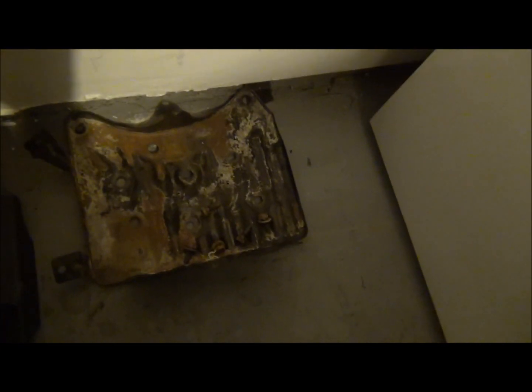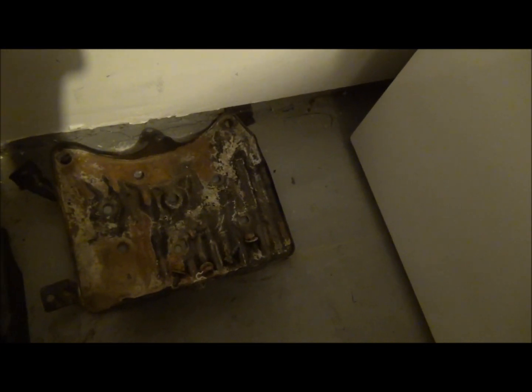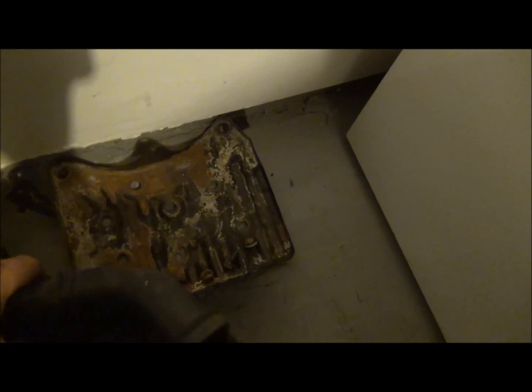There's a little tray underneath the battery, which is right here. And then you want to pull the actual battery tray out itself, which has 5 12mm bolts. About an 8 or so. Either way, there's going to be one back in each of these corners, and then these 3 you can see pretty easily. That's pretty rusted up, probably from a corrosive battery or something. I'm going to brush it off a little bit, clean it up, and I'm probably going to paint it back black. I'm in there anyway. It's my sister-in-law, and I would do this at my shop as well, just to make it look a little nicer.